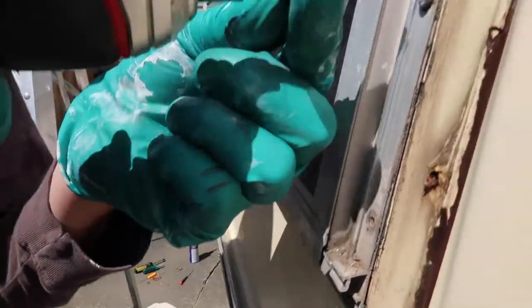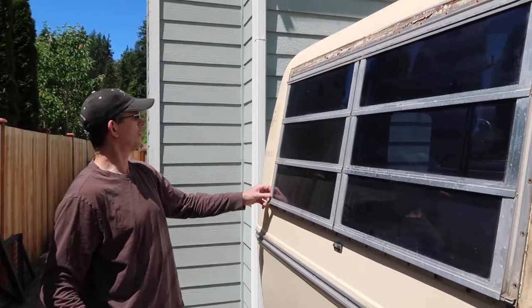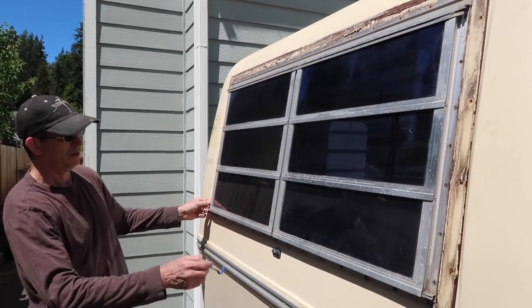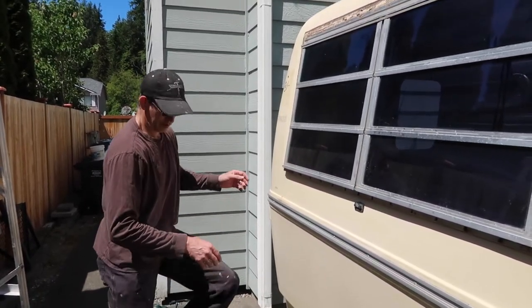This side is the worst - the other side wasn't bad. It's still taking on more water on this side, which is where the water leak started. There's some sort of wood frame under that elephant hide material. Once it gets a water leak, the water gets into the wood and the wood starts to rot, the leak gets worse, and people try to caulk it rather than fix it - which you can get away with for a long time if you caulk early enough. I took all the peripheral mounting screws out and slowly worked my way around the periphery.